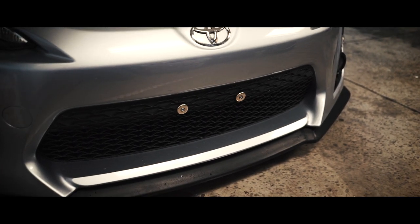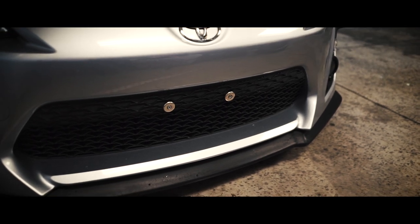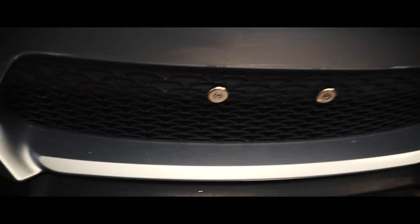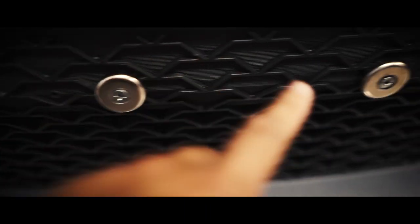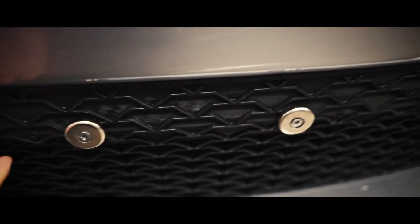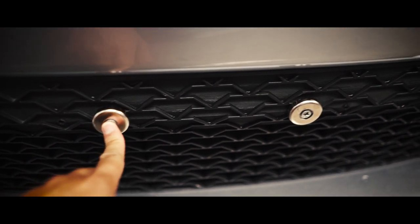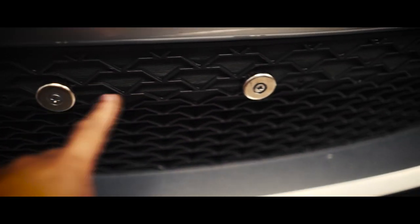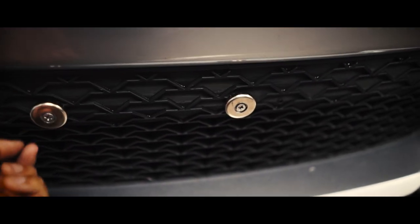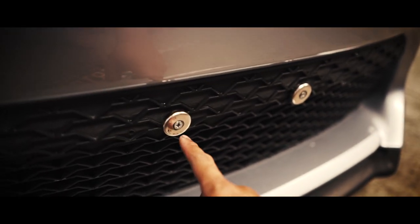With it on the car, this is how it looks. You have the option of painting it or just leaving it as is — I'm about to paint these black. As you can see, it's mounted on plastic and you could take off the grille portion and put a lock nut in the back, but on this I'm just using self-tapping screws. You don't want to over-tighten it or it'll keep spinning, get loose, and come off. To do this you use a countersunk screw.